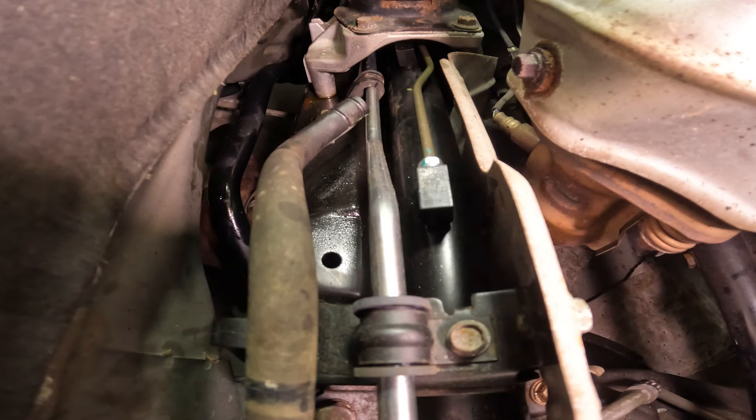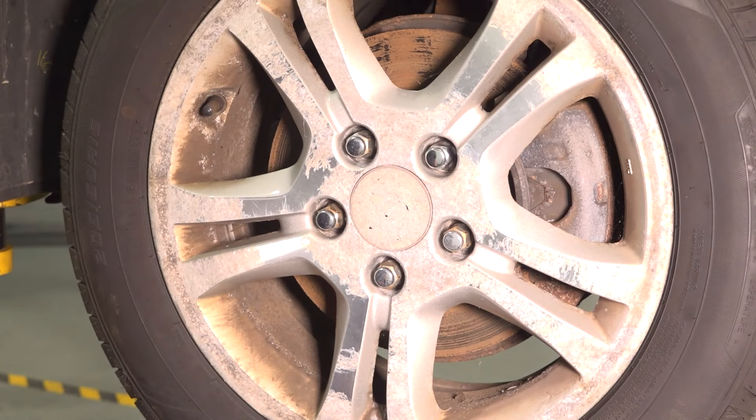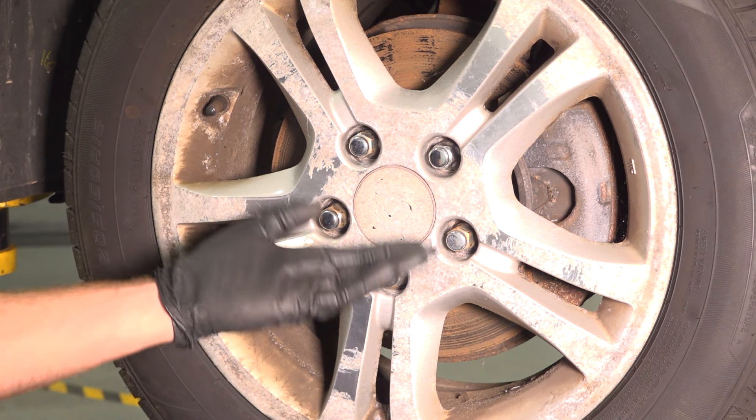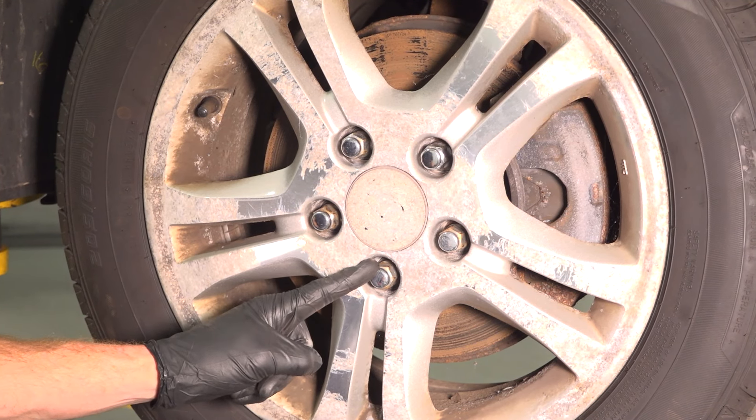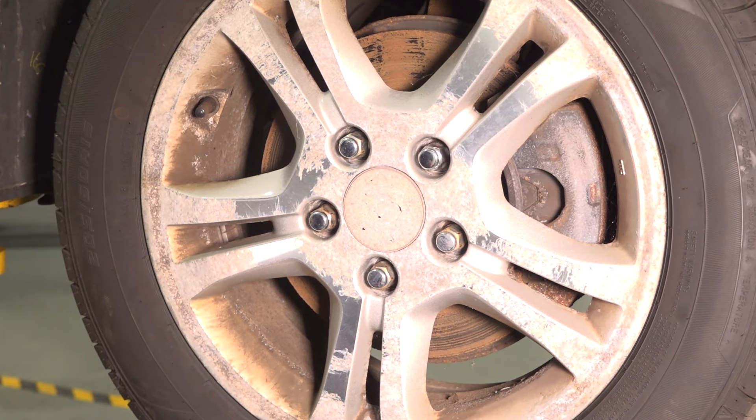At this point, you can continue on following that hose. You'll find that it makes its way directly underneath the power steering rack, where it connects onto the rest of the power steering line. To gain access, since it is underneath that power steering rack, you could carefully make your way underneath the passenger side inside of that passenger side wheel well and remove the clamp and slide the hose out of there. To gain access, let's safely raise and support the front of the vehicle, remove all five of our 19 millimeter lug nuts, and then the passenger side front wheel.